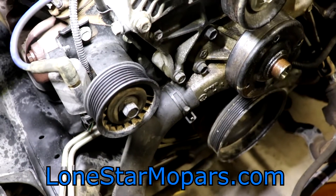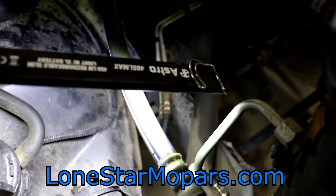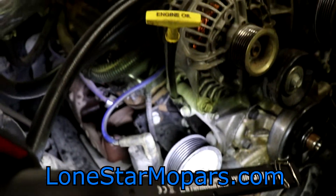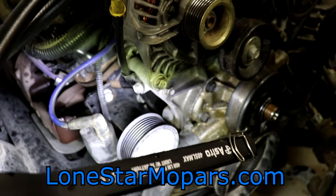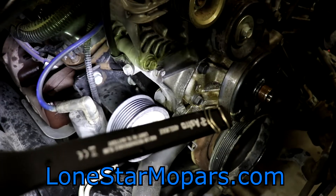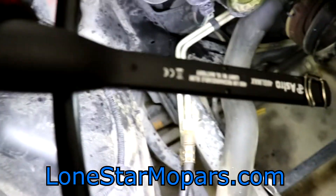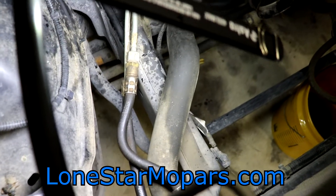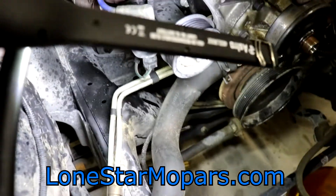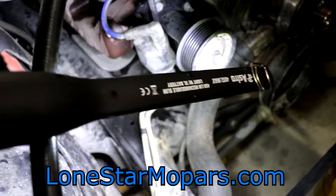This hose clamp on the other side of that pulley — that is going to be your bypass hose, and it tucks way underneath all of these accessories. That is a common failure point, as is the thermostat housing. Right now most people wouldn't even know there's a hose there, let alone the thermostat housing. Both of them are concealed quite well. We'll hop over to the bench and showcase that.